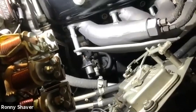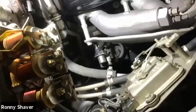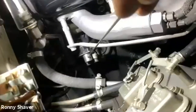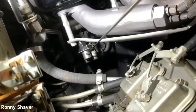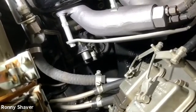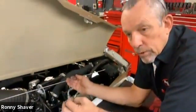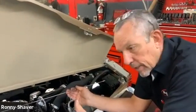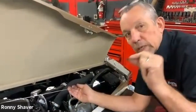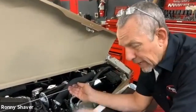I'm going to try not to short anything out. You see way down there — that's your remote solenoid. A solenoid is an electrically operated device that uses an electromagnet so that when you activate it, it makes contact for two really heavy load-carrying terminals. It's kind of like a big relay.